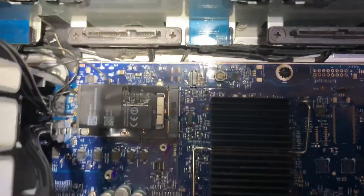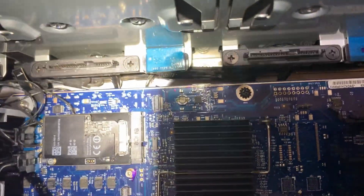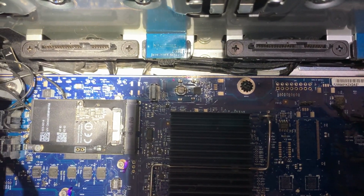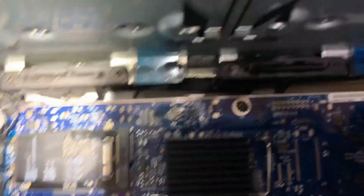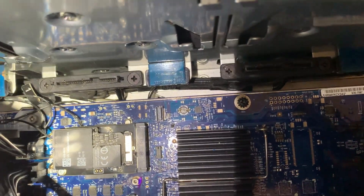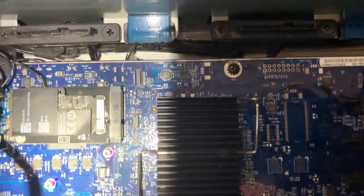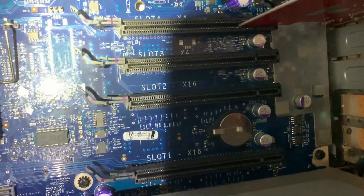And that's done. I found it was much easier once I took the card out — the Wi-Fi Bluetooth card came attached to the adapter, probably for shipping. It took me about half an hour to get all four of those antennas, hopefully all four still connected, into the right place. Then I got the card back into the adapter and turned the whole thing over, because it's got to be in there upside down, which is a pain. I wish they could have done it the other way around. But hopefully it's going to work. It took some effort to get the old Bluetooth card out, but I managed that as well. Now I've got to get the drives into place and get the graphics card back in.